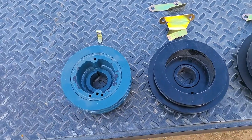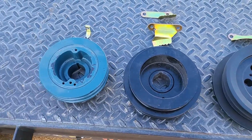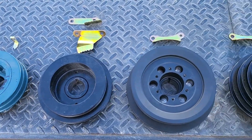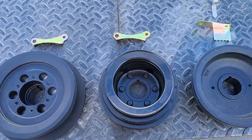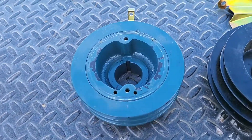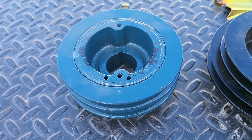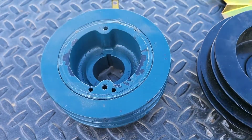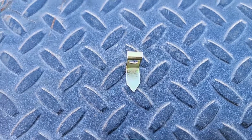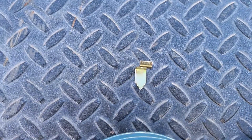Back to the pulleys. As you can see, there's a variety of different styles for each year, and I'm going to go through each one and explain them, because what I'm noticing is customers are mix and matching these crankshaft pulleys and indicators and it's causing a problem with what they think is a timing issue. Let's start here with the blue one — the L24. It's very recognizable. The pulley is a dual groove: one is for the smog pump and the other is for the water pump. It has a timing indicator that is just a pointer, because the markers — those notches — are on the pulley versus on the indicator like they are in later years.